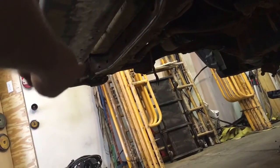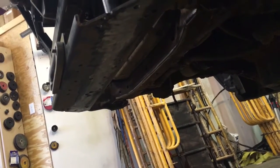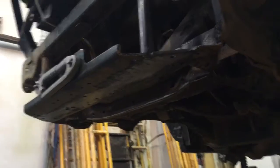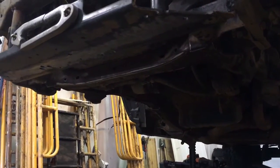We're going to be basically adding the leaf spring hanger kit to the bottom of this assembly, down the length of this whole part of the front end of the frame, and we're going to weld it up tonight. Just tack it up to see how it's going to end up, make sure the leaf springs are where they should be and the shackles are at the right angle.